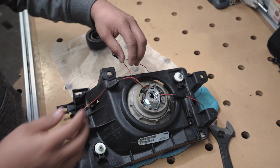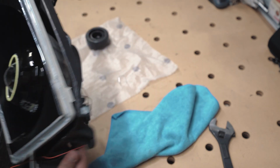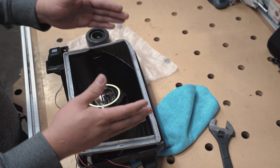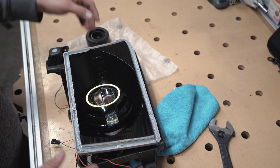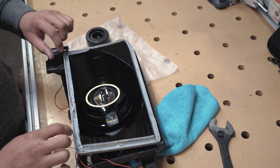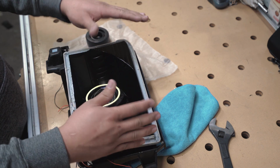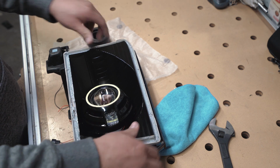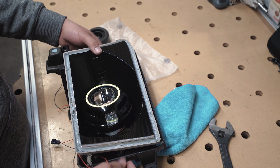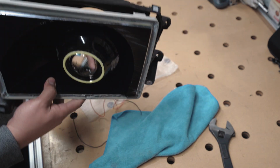All right, so that's pretty much all the steps. Now you can go ahead. The final step is to put the glass on top. Take this to the oven, preheat the oven again, leave it in there for like 3 to 5 minutes, just so that this gets nice and hot. Once this glue is warm and the glass is on top, you'll be able to press the glass into the housing and just set this aside for, I don't know, 20, 30 minutes or less, so it's cold to the touch and you're all done. You could pretty much install this now.